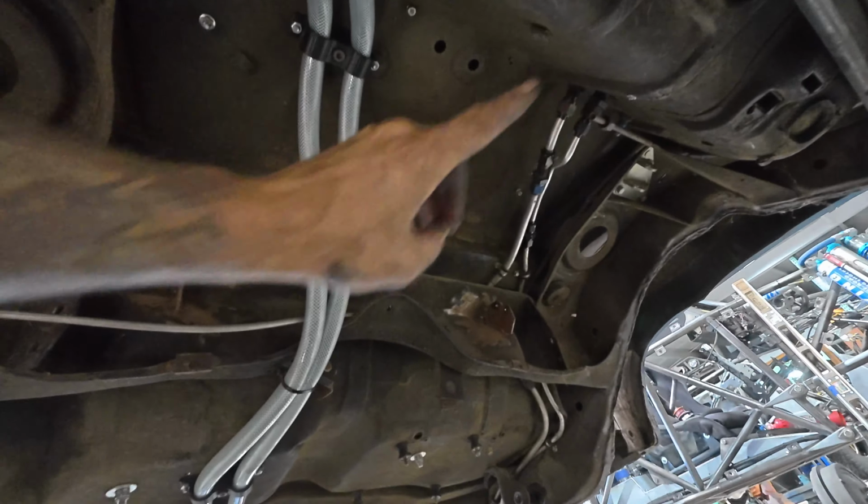So I'm really trying not to cut the body mount out right this second if I don't have to. But I was like, man, if we just sawzalled it flush here, right, along the frame all the way up, because I can put my hand on the backside, so we can fit the blade there and just kind of do one of these, that gets it off of here, and then grind these 3 dudes down on both sides. We should just be able to knock this thing out.